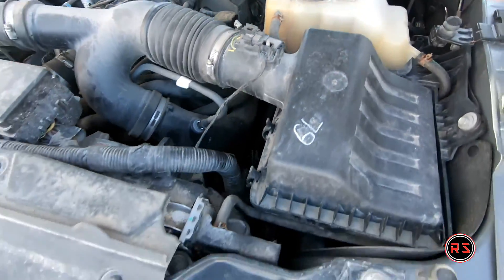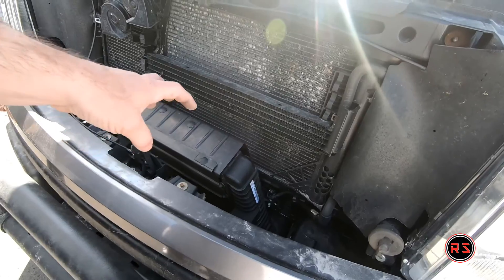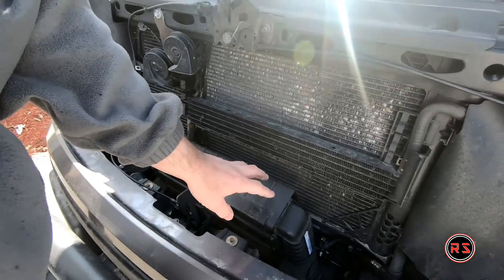It gets into the turbo and then goes into the intercooler. There have been a lot of misfires and malfunctions reported on multiple forums because after the intercooler gets dirty enough, it starts sending very bad stuff into the intake, turning the high efficiency of this engine setup into a bad recipe for disaster — misfires and all kinds of bad stuff. This is why the EcoBoost needs a catch can more than any other engine, because it's turbocharged and all the bad stuff goes into the intercooler, the turbos, the intake, and finally the engine.